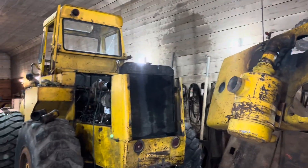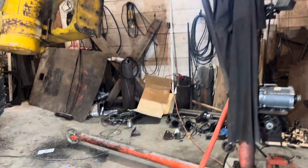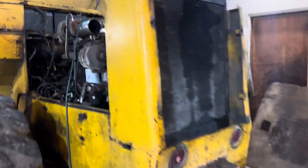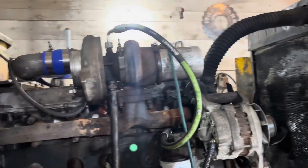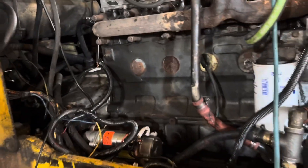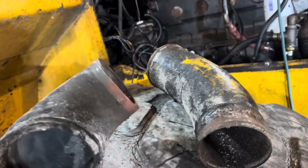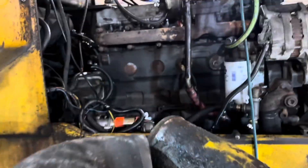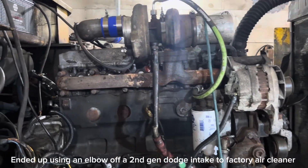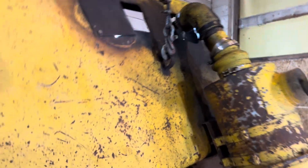Well, time has come — we're putting the hood on, she's going up. The only thing we don't know about yet is if our alternator is going to charge. I loosened up some wires and tried to clean everything up a little bit. We're no real professionals. I think all the turbo intake air plumbing is going to work except for this — the turbo on the old big Cummins has a lot smaller intake than this HE351, so we need a 90-degree elbow with the same size on both ends. Looks like it's going to work.